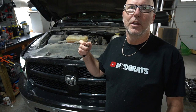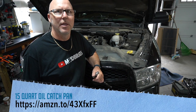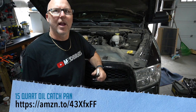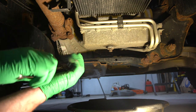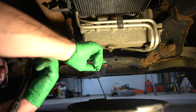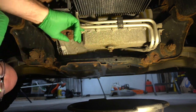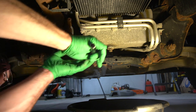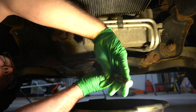It's been 15 minutes, so I'll shut this thing down. I've popped the key out of the ignition and I'm going to set the keys on the bench to avoid any accidental starts. Next you need a big oil collection container — you can get them at Amazon — and a 13-millimeter socket to crack the bolt loose. Have your oil container ready; rubber gloves are nice since this is going to be pretty warm oil when it comes out. The oil drain plug is a 13mm, just behind the front brace. Remember, lefty loosey, righty tighty — make sure you check your ratchet direction before you put it on.